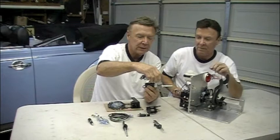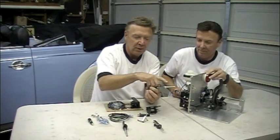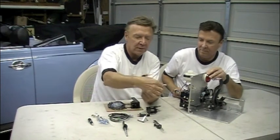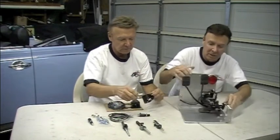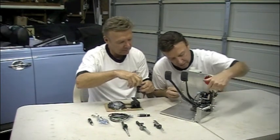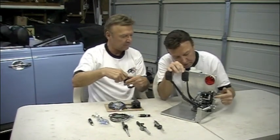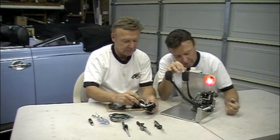From this side right here, you'll see exactly how that works. It's off of the brake push rod — we call it the actuator. This is the key component. We're using all the same German stock equipment that came with the car. All we're doing is adding an actuator: you just screw out the rod and screw it back in together, then set it back into place. Here's the switch, here is the swing arm assembly, and here is the interlocking actuator. You can see that the moment I move the pedal, the swing arm is moving with the actuator and the light is going to come on and stay on.